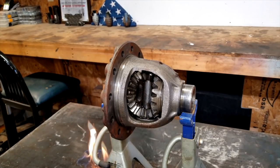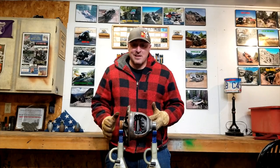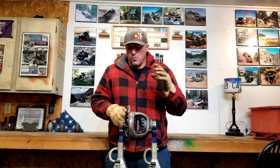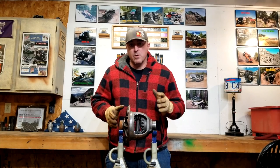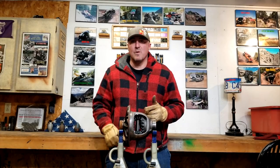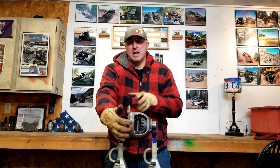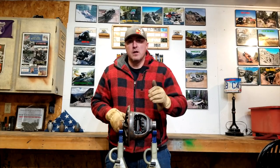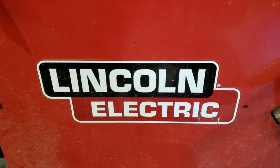Now that we've got everything cleaned up, we know it's dried out and I've hit it with fire so it's not going to blow up in my face when I hit it with an arc, and we are ready to go. A couple things to always make sure: you definitely don't have any gear oil or fluids anywhere near where you're welding — which is kind of a no-brainer, but I've made that mistake and had a pan of gear oil on fire before. Secondly, this will make a lot of splatter, so if your ring gear or pinion is on, try to take a fiberglass blanket or something and wrap those up and protect them before you start welding, because you will get a lot of splatter coming off these oiled-up side and spider gears.